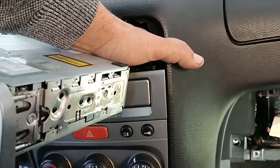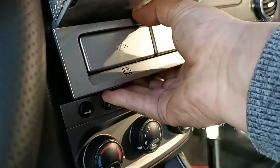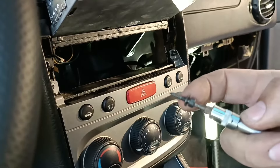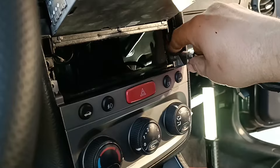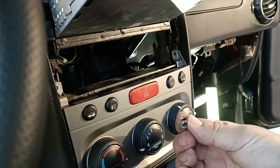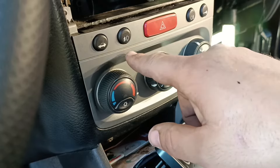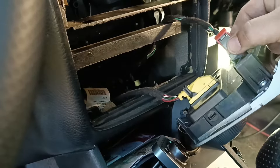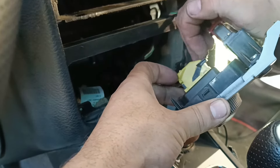Pull the stereo to one side, then with your hand pull on the back of this panel. Be careful with personal belongings. You'll find two screws with 3mm heads. When pulling on the lower area, you'll have two clips. This lower area is a separate unit and depends on the version of the car — some don't have front fog lights. You'll see a connector for the top module and one for the bottom.